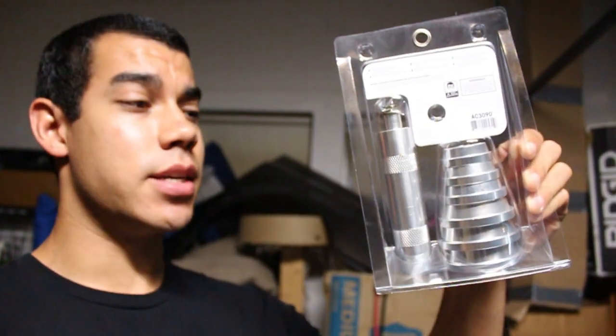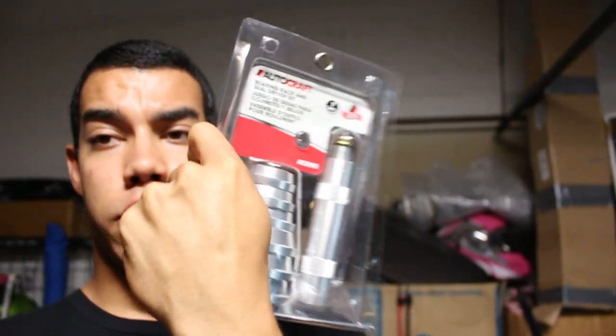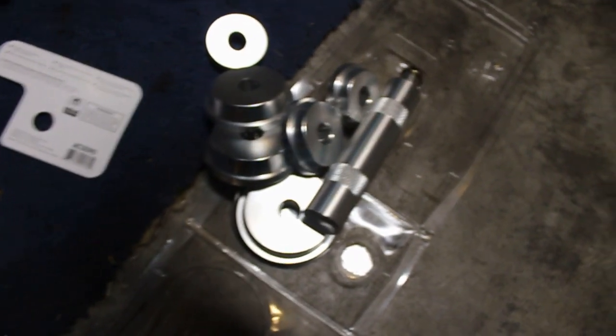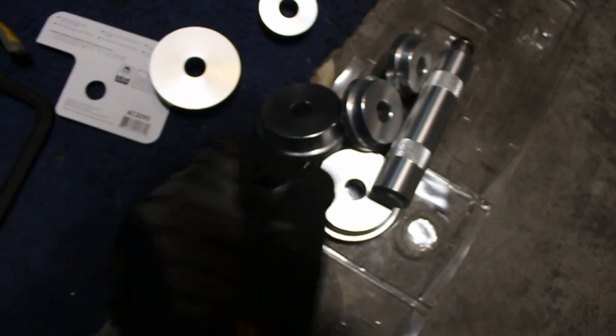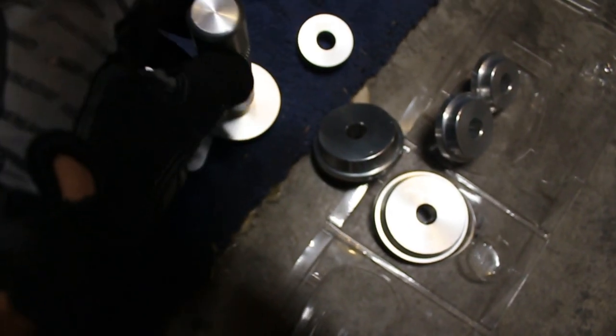So many hours have gone by, but I'm back home and I have this - it's a bearing race and seal seat driver tool. That way I can actually get my races to go back in and we can finish this up, because my car's been sitting like this for hours. How this works is you find the size that fits your race, put it inside, use the tool, screw it in the top, and then hit it with a hammer and it goes in.